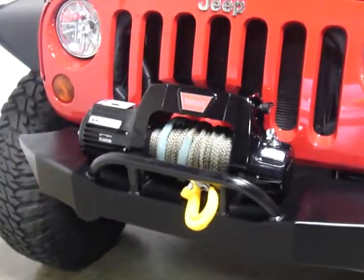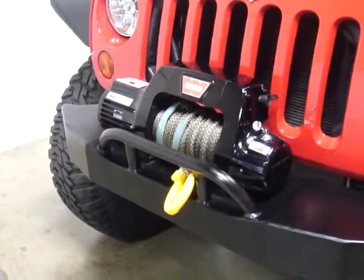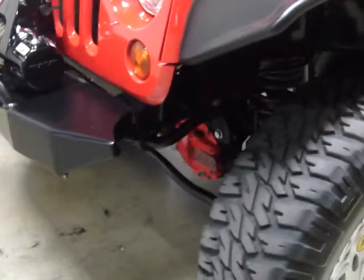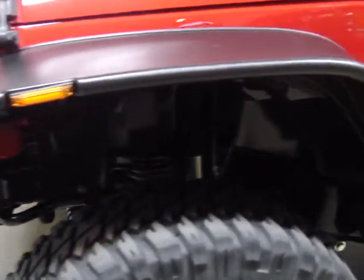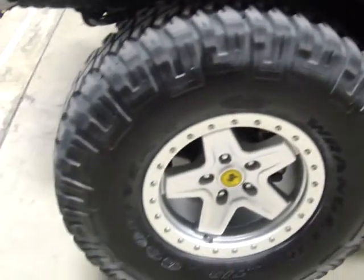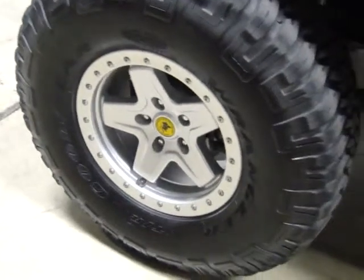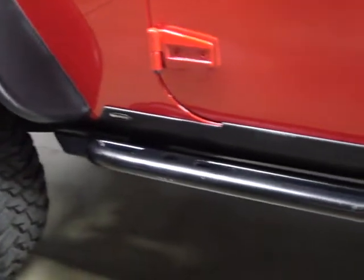As you can see, you've got a heavy-duty Warn 9.5 winch on the front with remote — that's a recovery gear synthetic winch line — and a custom bumper. You've got Bushwhacker fender flares, an AEV nth degree suspension, and AEV beadlock wheels fitted with Goodyear 37s — that's a Wrangler MTR. You've got a custom rock slider here.